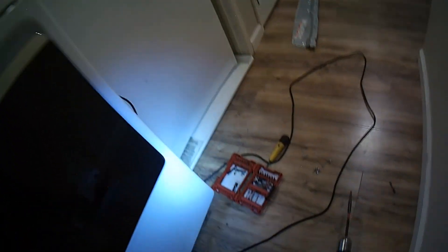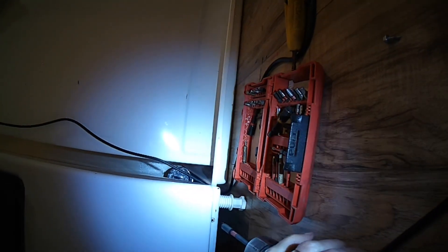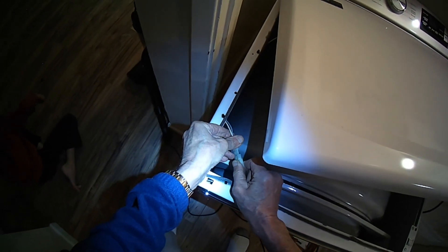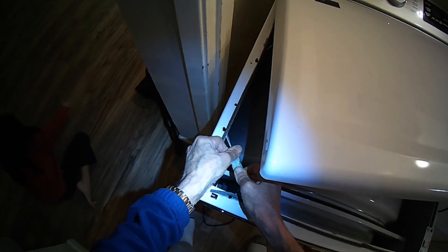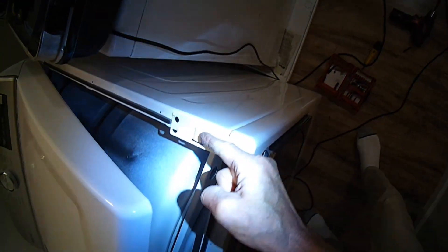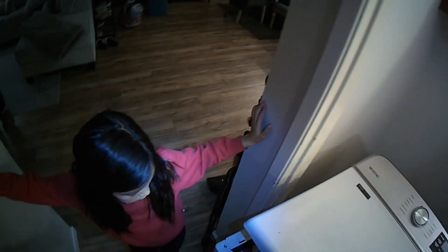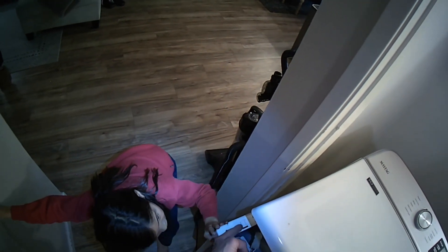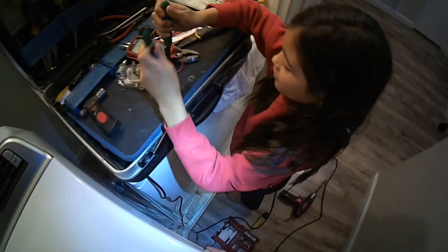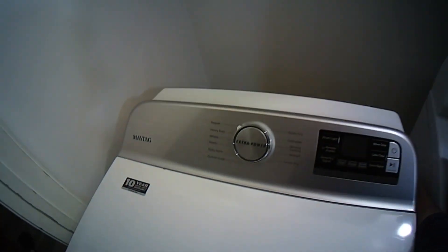That one has good continuity. So it was just the element that had broken, which is a little unusual — it's usually going to be the thermal fuse or the high limit on the back. There's no polarity issue, so the leads can go either way. We put on these two screws and the little cover, then we're putting the filter cowling back — goes up and over, go in here first, then slide it up, and we'll add the little screws to hold it. My assistant Lily is helping hold the cowling while I drive in those screws.